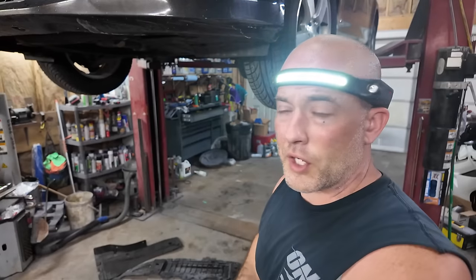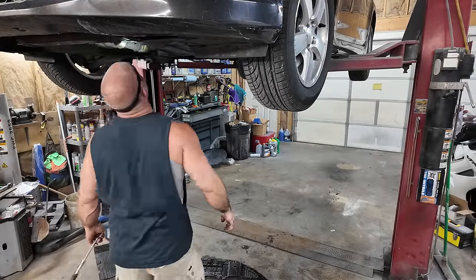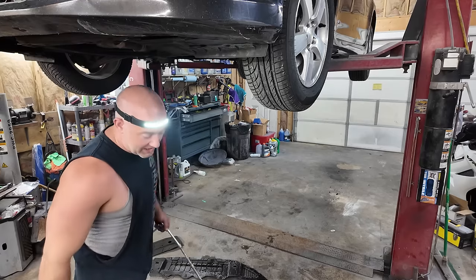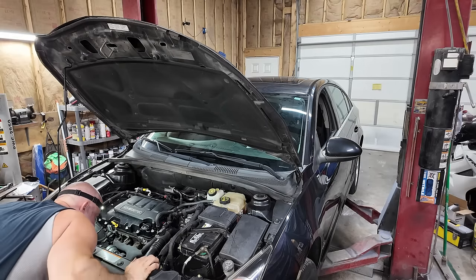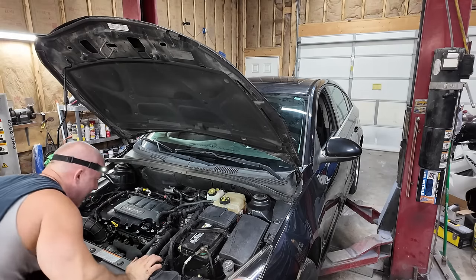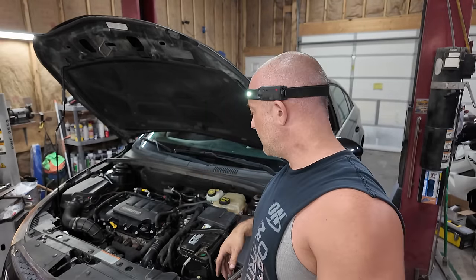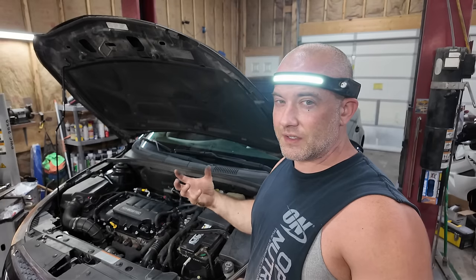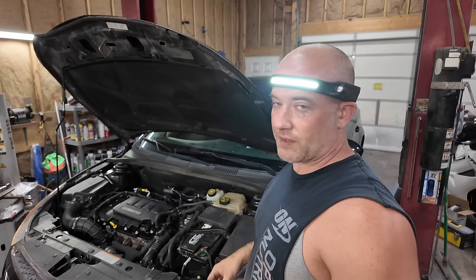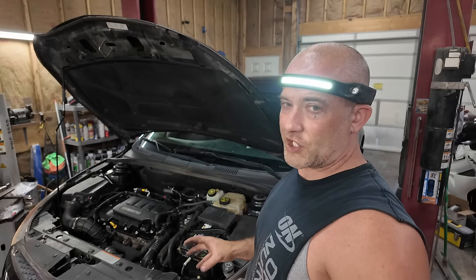On another note, I'm pretty sure we've heat cycled at this point. Nothing's leaking that I can see. I'm gonna put it back down now and check it over. Still dry. Yeah, now I put the AC on. Now we're gonna let that run. It should heat cycle at this point. I wanted to open the thermostat so there's pressure in the system, because that's the only way you're really going to tell if there's a leak, when it's fully pressurized.